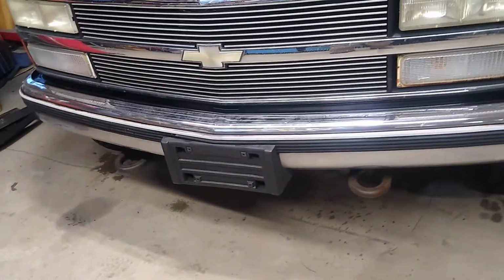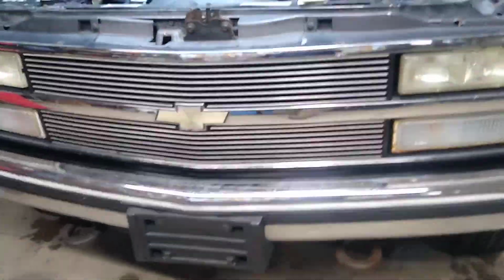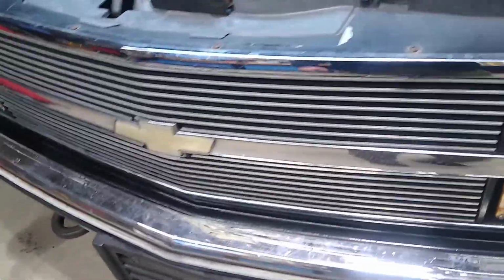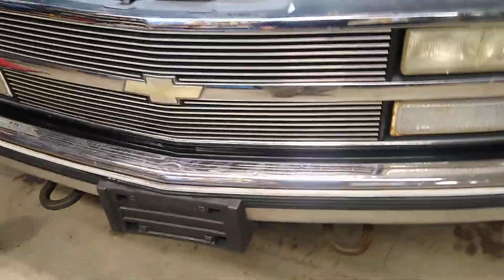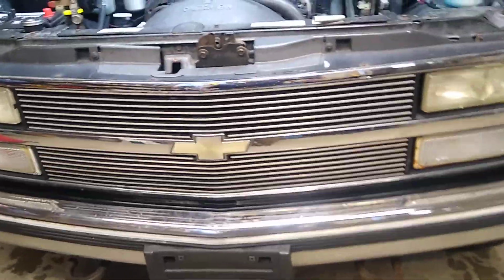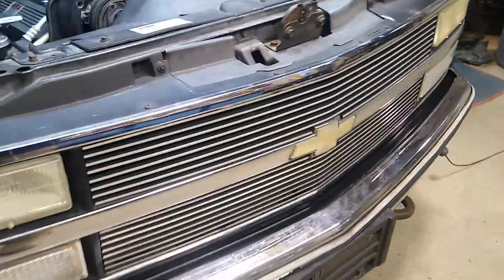The vehicle was leaking fluids from the front end for a long time, and that's water on the floor, not fluid now, but it was leaking fluid. I knew that. It was kind of on the underside of the engine and the shields under the motor. And what I found out is that there's an aftermarket transmission oil cooler attached to the front of the radiator, which was leaking. The connections were loose.